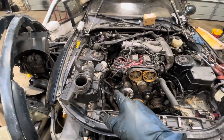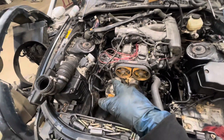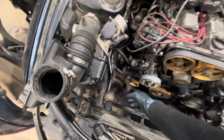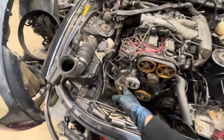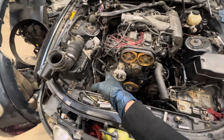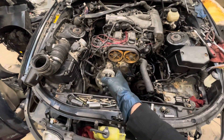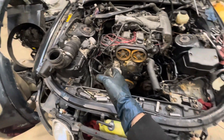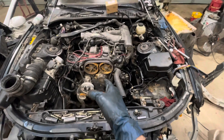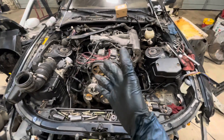I got to cover the alternator that's getting power. There is that extra connector that I told you guys about for the alternator. That's just because instead of it being on the engine harness, it's on the chassis harness, so there's two now. Hopefully that works out just fine — I think it will because I have the 92 ECU hooked up to it.